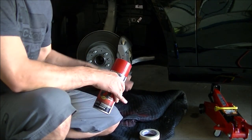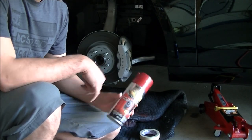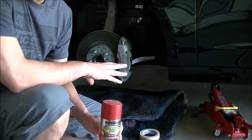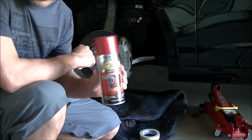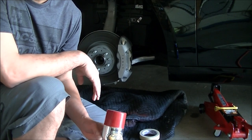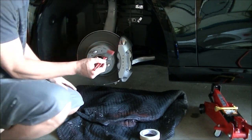There are two ways you can do this. You can tape everything up all around and then spray it on — I'm using this Rust-Oleum caliper paint. Or, what I'm going to do this time is spray the paint onto a brush and brush it onto the calipers. That's actually much less of a mess. The paint is a little bit thicker but there's less chance of the paint running if you put on too thick of a coat, and it still looks pretty good. I've done it both ways, and I do think spraying will look a little bit better, but for the amount of prep work involved I'm not sure it's that much better. I just sprayed the paint into a reservoir and then I'm going to use the drippings from that to get the paint.